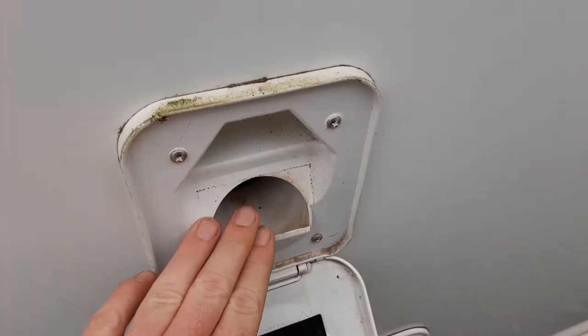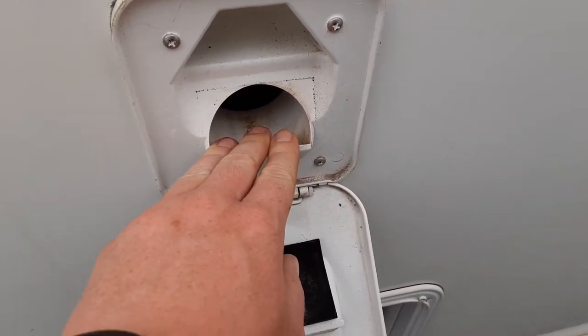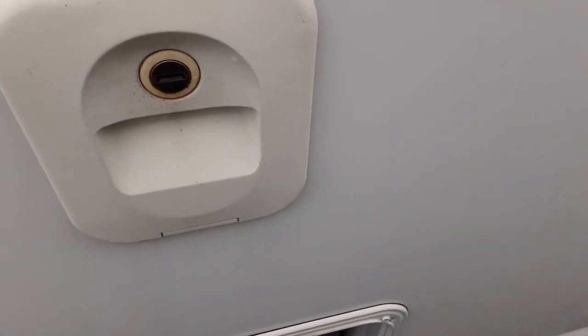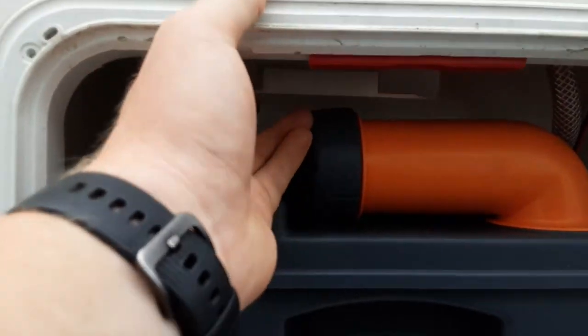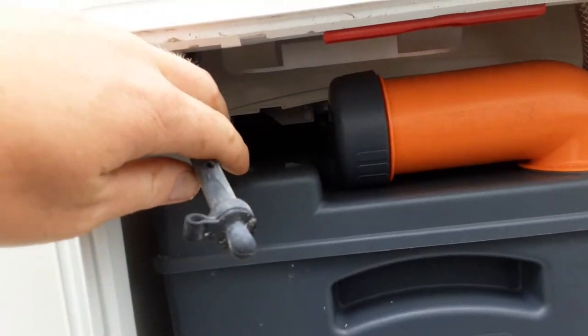Then you've got your toilet flush tank. You'll put three and a half litres of water into this tank and a capful of the pink fluid, and that's essentially your flush tank filled. We do advise you to drain that down before you travel, which you do by pulling out the bit of black pipe down the side here and pulling the cap out at the end.